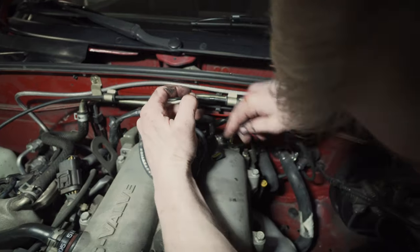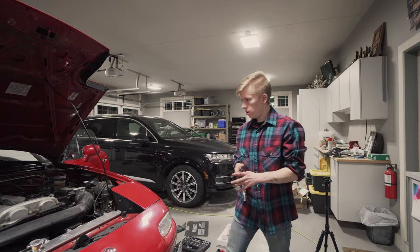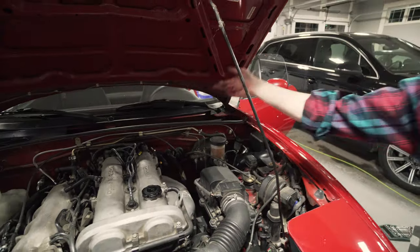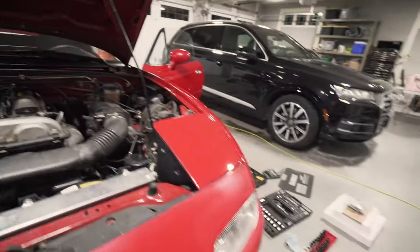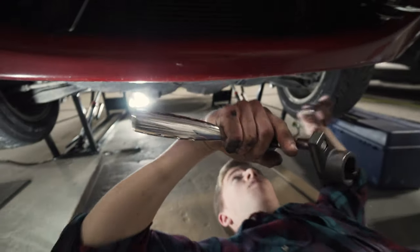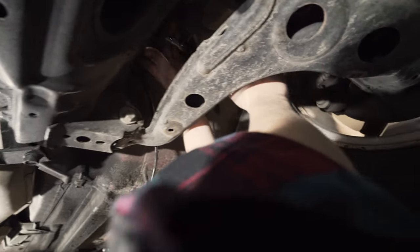Yeah, it separates on that side. But now how does this guy come out of here? Oh, it's just one of those pincher guys. That's the part that goes to the O2 sensor. So, we got that connector undone. I tried to unsnake the O2 wiring out from behind there. It looks like it's basically free. We've got this O2 socket that the wire can fit through. So you can see our plug is now down here with us. And we're gonna undo the O2.